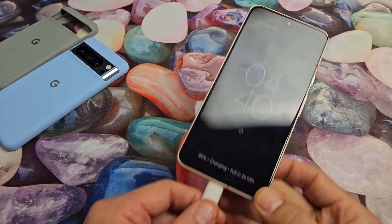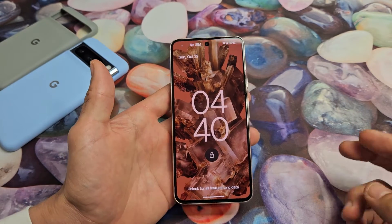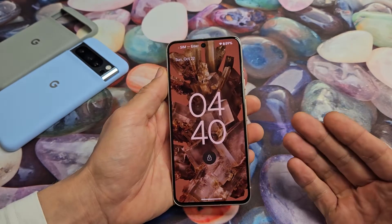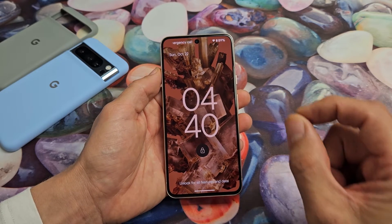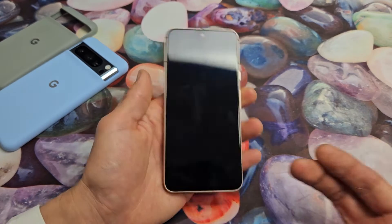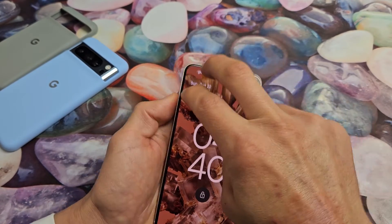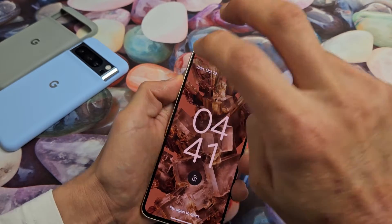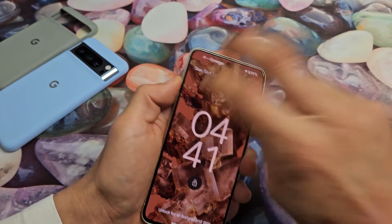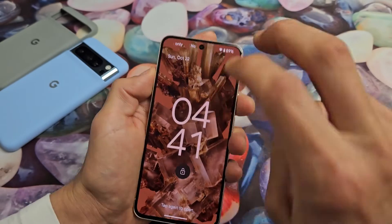So you still have a black screen — no problem. Next thing we're going to do is what I call the tap method. What we're going to do is hold two fingers like this, and tap all over on the screen and all over on the back. The whole premise behind this is you might have a cable ribbon slightly dislodged that can cause the black screen. So pretend my screen here is black — hold the phone like this, get two fingers, and tap kind of hard all over. Sometimes as you're doing this, all of a sudden the screen might turn on. Maybe you'll get half a screen, maybe you'll get white lines — just keep on going.